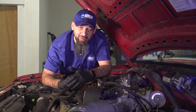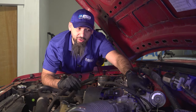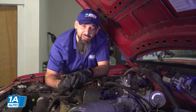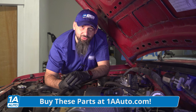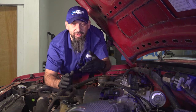Now for our next problem, it's going to be under the hood — your EGR valve, right back here underneath your windshield washer motor by your firewall. This is part of your emission system; it recirculates exhaust gases. If it fails, sometimes it causes rough idle, rough running, and sometimes stalls as well. If you're having issues like that, check your EGR valve — sometimes they're stuck open or stuck closed due to carbon buildup in that system.